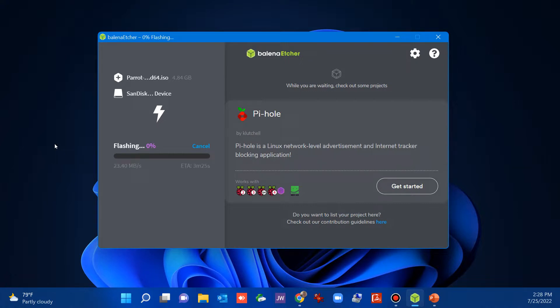As this writes, we're going to get ready for the next part. I'm going to be in Linux, so I'll have to pause the recording and switch over. Once your USB is flashed, you'll need to boot your computer into Linux. Unfortunately, I can't walk you through this part because the procedure differs depending on your computer or laptop. Look up your specific desktop or motherboard model and search how to boot from a USB thumb drive — usually there's a simple option like pressing F8 or F12 to bring up the boot options menu. On certain UEFI or BIOS motherboards you may need to disable or enable features such as secure boot. Select the USB as your boot device and you'll be in Linux, ready for the next portion. Thanks for watching.